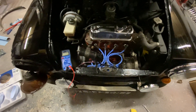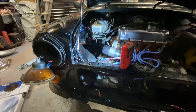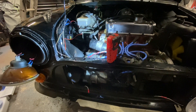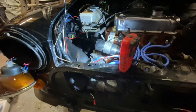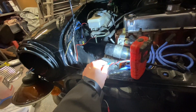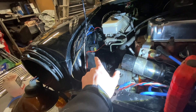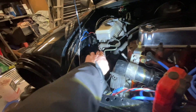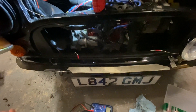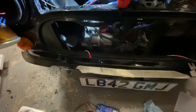Welcome back - I now have them wired up and working. I didn't really deviate from what I described. I tied into the starter motor for my feed, the blue-white wire for the signal, and the horn bracket for earth. Got it mounted in the inner wing - a little difficult to get a screw through the ring because there's not much room for a drill. Feed runs down to the two spotlights and that all worked fine. One tip: I hadn't tightened the brackets when I first tested it and one light came on but not the other - because these earth through the brackets, so make sure they're tightened.